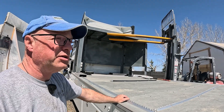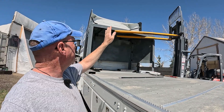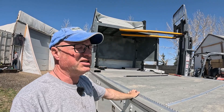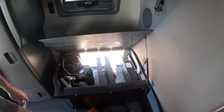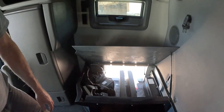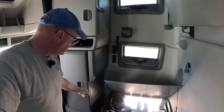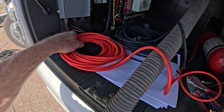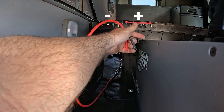I haven't quite decided yet whether I want to do a single solar panel on top of the drum box or cantilever two of them out a little bit beyond the edge of the drum. Here inside the sleeper space, we can see how those solid state batteries are oriented. For the inverter control, I'm probably going to put it on this wall, running inside the cabinetry across the floor to the 3,000 watt pure sine wave inverter, and pulling 8 gauge power and 8 gauge ground across to the positive and negative bus bars on this side.